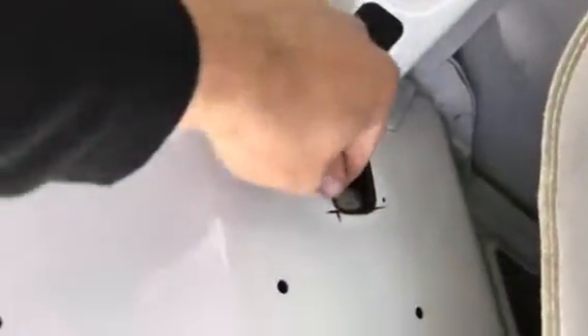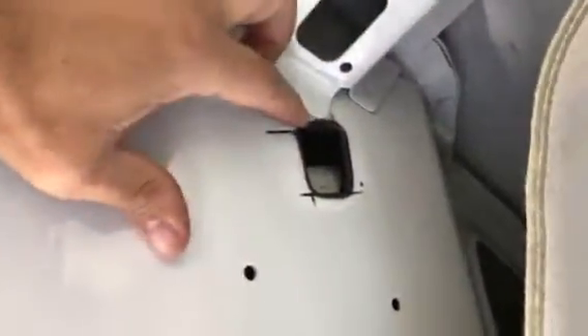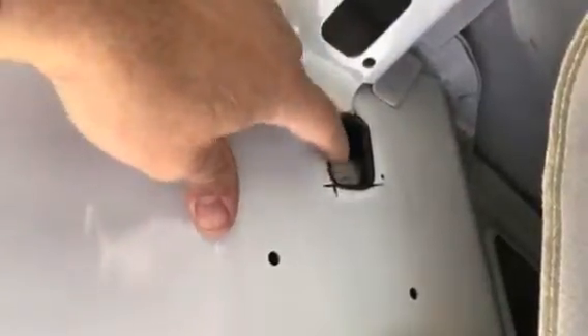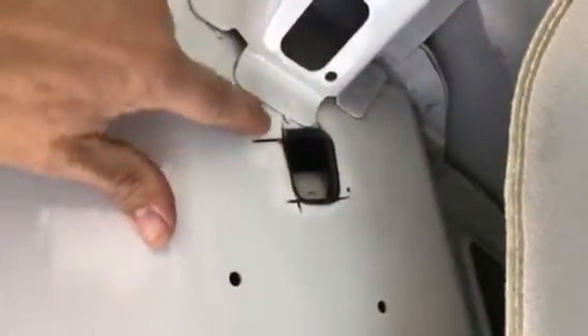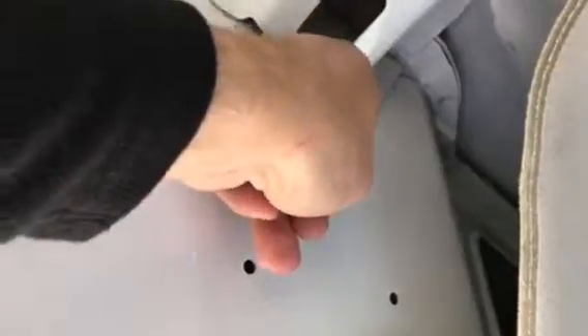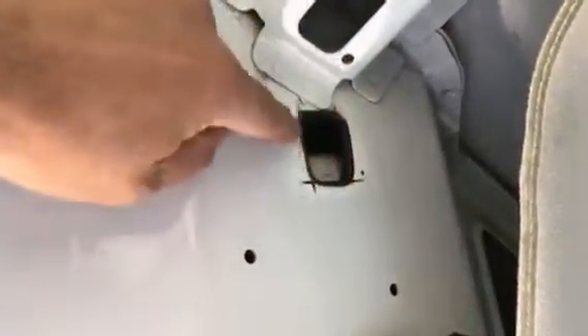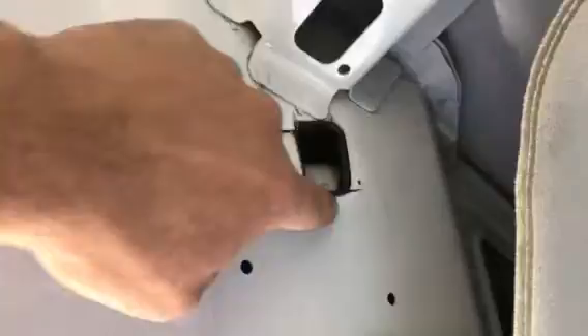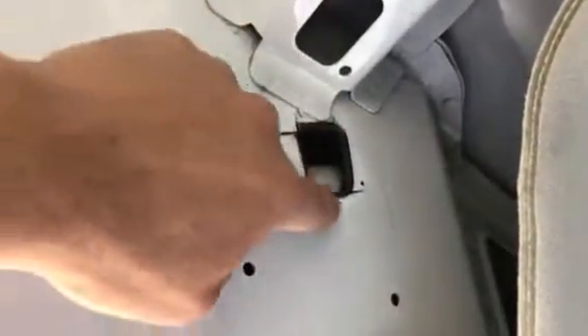I'll be cutting here — this is going to come off and run through that hole. Let me show you the hole: this is all I cut. I normally make a cleaner cut — I'm really a perfectionist. I tried to drill a nice clean round hole but the hole saw was giving me trouble, so I had to use a grinder a bit more than I should. I spray painted it with white primer and used that same irrigation tubing to protect the metal.